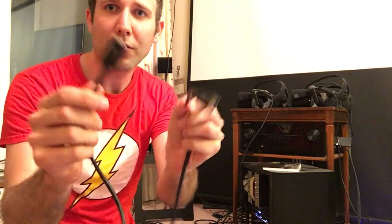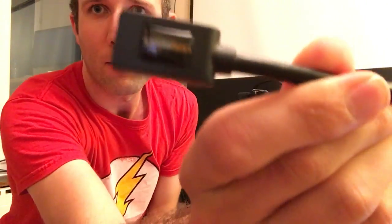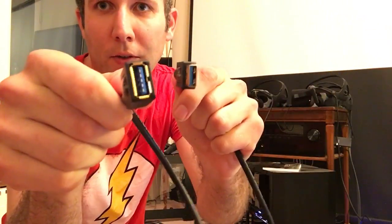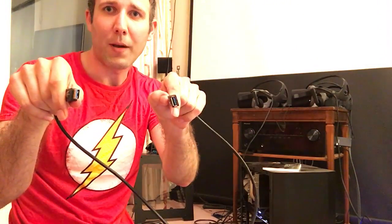That one only seems to work with the Inateck card as USB 3, but there's a bit of a question mark with the Inateck card in general because of the red warning. Next one - passive cable, Amazon Basics. That's just a 1-metre cable. That works on everything. Plug it into the Intel ports, the AS Media ports and the Inateck - everything detects as USB 3. Works on all of them. Amazon Basics 1-metre passive extender definitely works on everything.